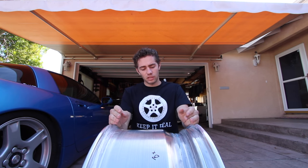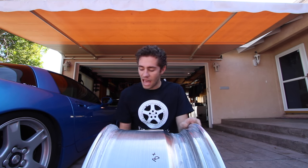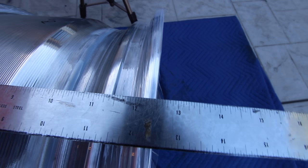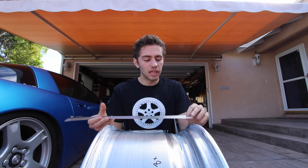The first couple of things to take into consideration is that the overall width and diameter of the wheel is not quite as it says. The width of this wheel is 11.5 inches, but when we measure the overall width it's about 12.5 inches — so that's an inch over the stated width. From my understanding, the width they actually measure is the inside of the lips, which measures right at about 11.5 inches.